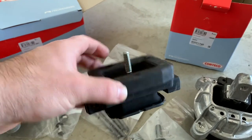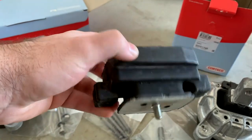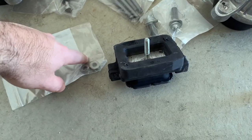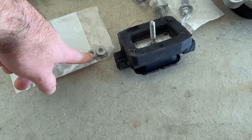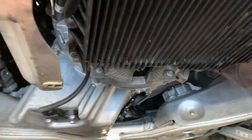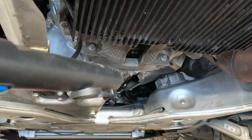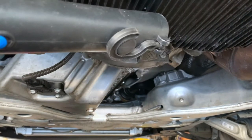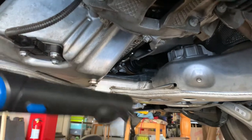This rubber piece is pretty straightforward - you just unfold it at the bottom, flip the top down. The nuts for the transmission mount are also 13 millimeter hex and they are also 20 Newton meters. This is the underbody in drive direction, so this is the front, this is obviously the transmission, and this appears to be your engine oil pan.